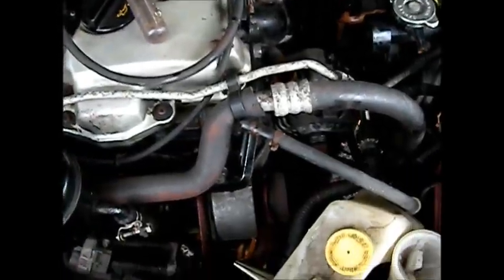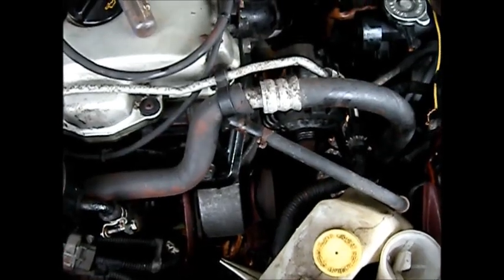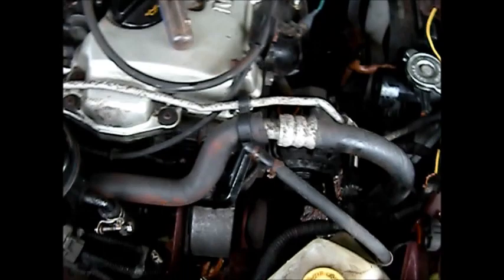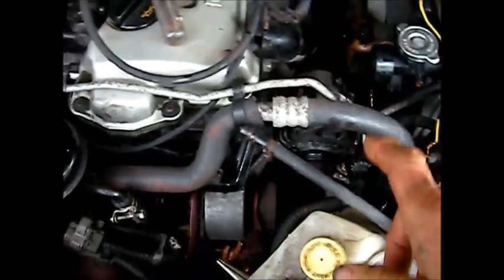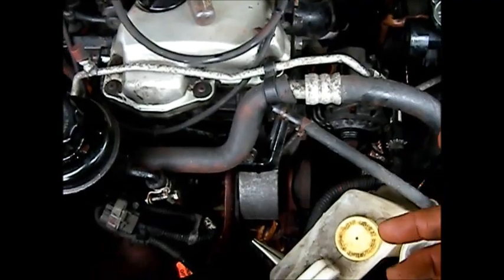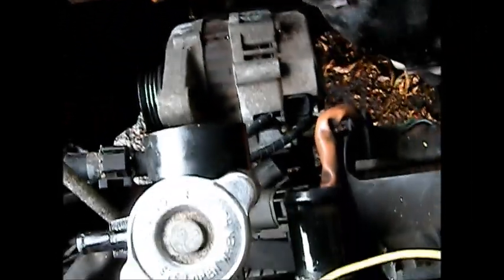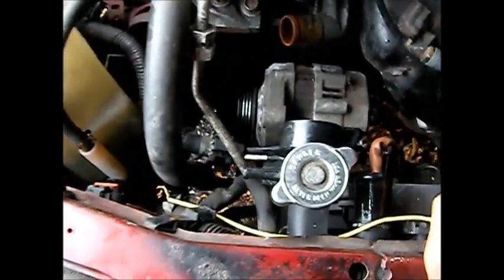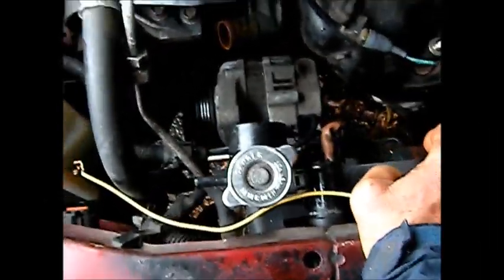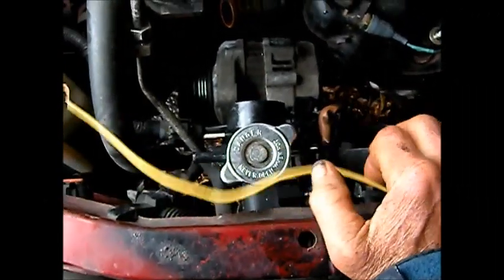Okay, so here's the alternator job. This would be probably part two of the alternator thing I just checked on. They have these at AutoZone for like $99, that's the bottom line. 99 bucks, plus 25 for core. I double checked the grounds on it, put an extra ground wire on it just to make sure it didn't have a ground fault.